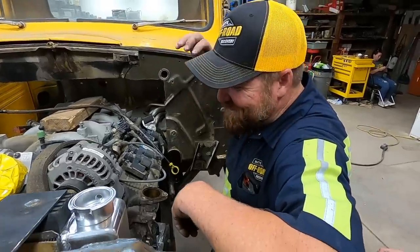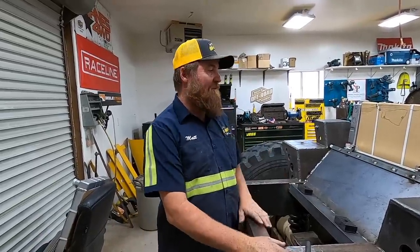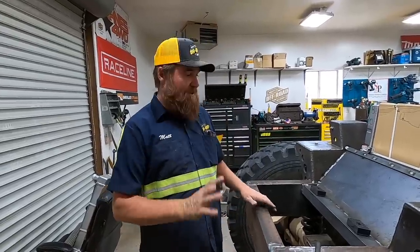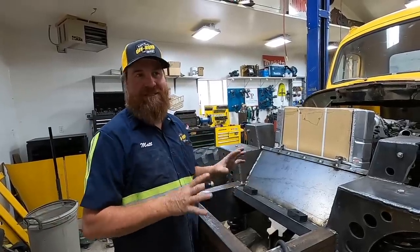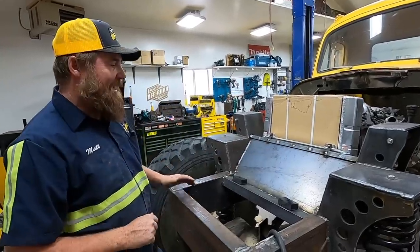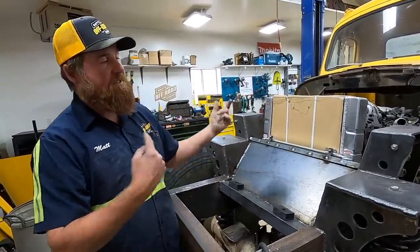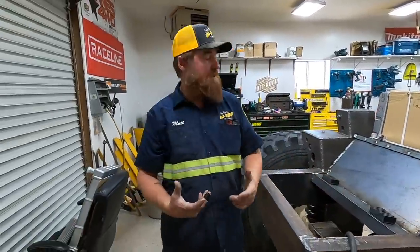Good morning, it's another day of working on the wrecker. I've been working on a little bit behind your back, so I'm going to tell you what I did so we can bring some trust back into this relationship. I'm working on a system that I hope does an adequate amount of cooling. This is the system as it stands right now — I have a radiator right here, this is the secondary radiator, it's going to be in series. This one gets its juice second; there's going to be another radiator right here.